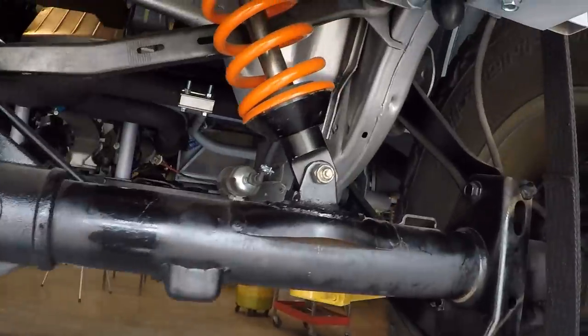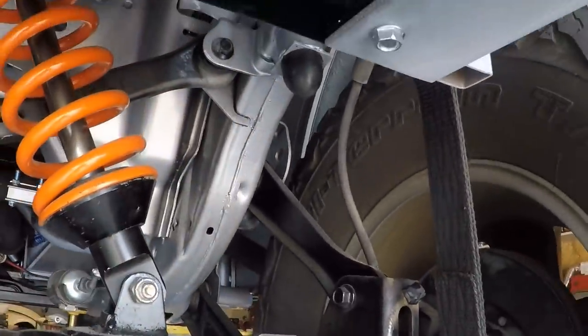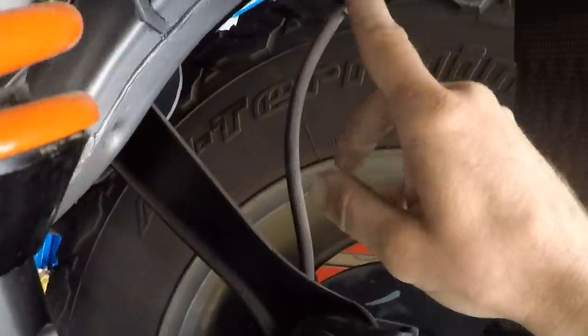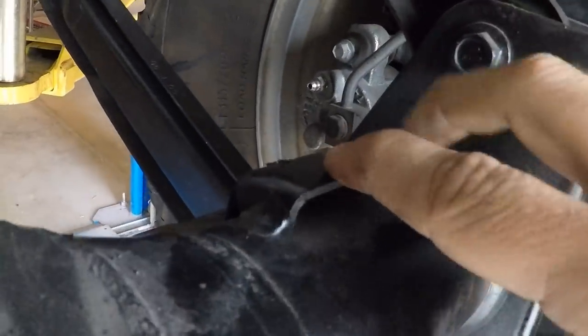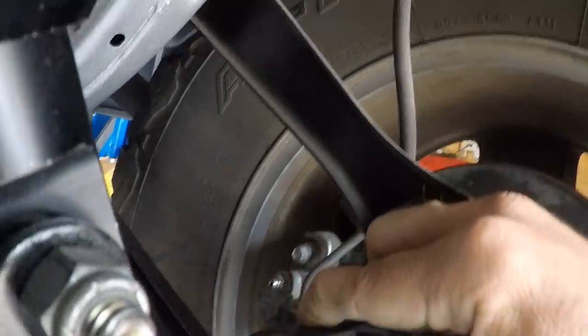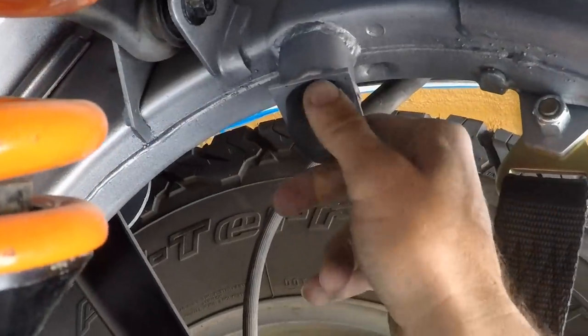Let's just jump right into that suspension. All right, guys, a couple things from the recent test drives. If you notice, the bump stop on this side is different than the one over here that was originally on there. This bump stop was ripped off, I mean, the old one. This is a replacement temporarily. It made contact with this pad. I don't know why it was smashed, because it seemed to make clean contact right in the middle. But for one reason or another, it got ripped off. So this is the new one temporarily.